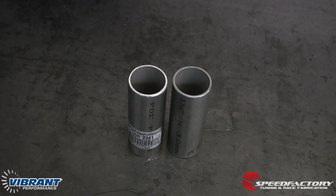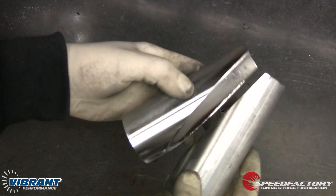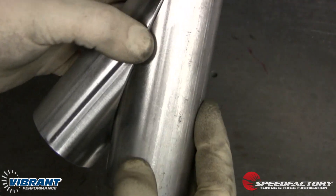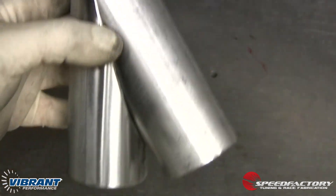Here's two pieces of the inch and a half scheduled 10 tubing, which I've cut to build one of the collectors. The next step is going to be to put them in a custom jig that we built to achieve the desired angle of the merge collector. I have the first set of collector pipes cut here with our jig. I'm pretty happy with the fitment on that, so I'm going to go ahead and make another one of these and then do the final surface preparation, and then I'm going to weld both of these collectors together.